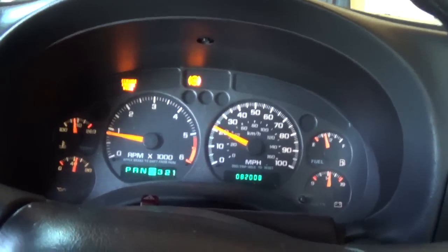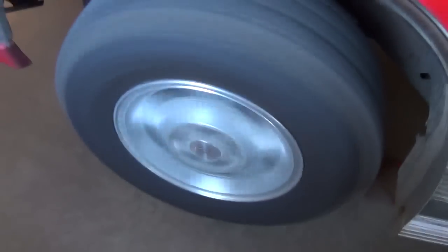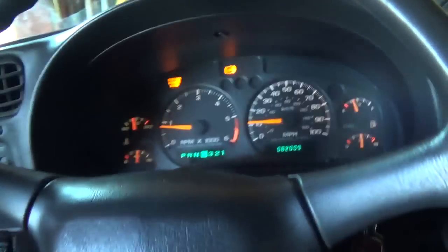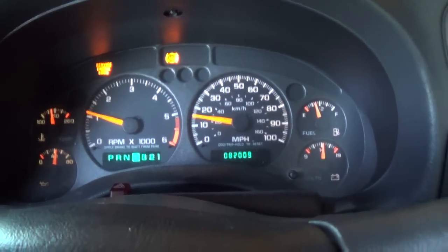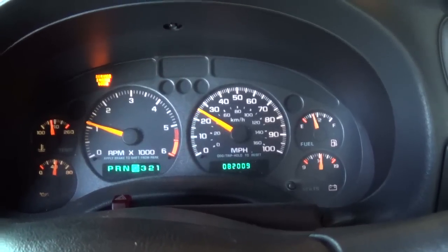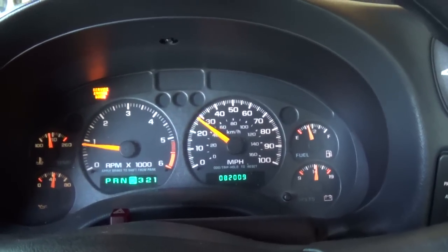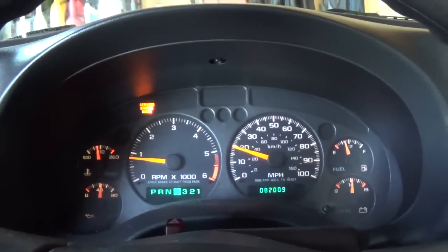The ABS isn't happy, but I definitely heard the wheel bearing sound there. Now we put the block under the left front wheel and let the right front spin free to do the same test. It's a lot quieter. So yep, the left front — that's my call.